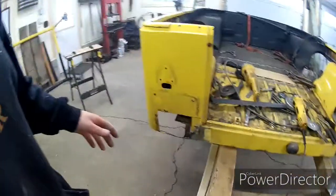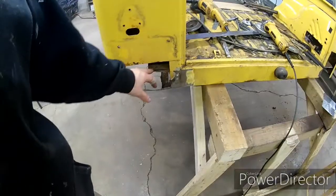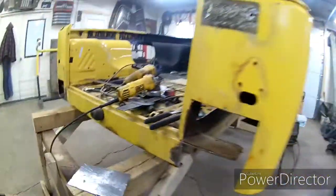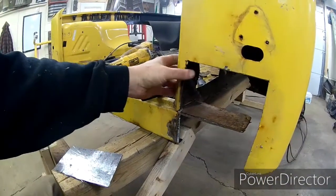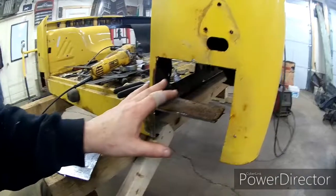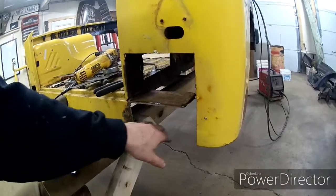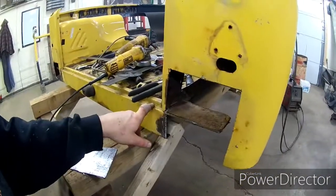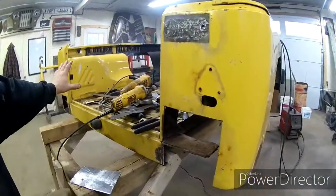As we cut away some more rust - typical on the old Jeeps, these corners always rot - we started digging in a little bit farther. This side here had the mount for the tailgate hinge, which is a brace that was inside of here, and that rots out on all of these. So this is the support structure at the bottom - it used to be a box tube. This is going to be the front of the trailer, so we're not concerned about trying to support the structure of the tailgate because we're closing all of this off anyway.